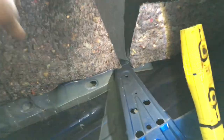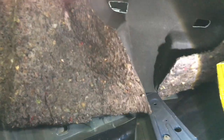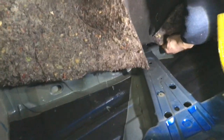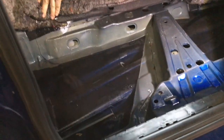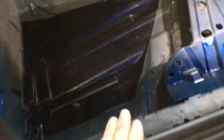This has got felt material — it's not the normal. Most cars have foam, and foam can hold the water and it can be a bit more difficult to get the water out, but it does come out. You have to get a suction machine on there and suck it out. The water at the moment you can see it dripping off, but that's because it's fine on the lowest level. So because it's only wet on one side, we're going to strap the carpet up and then suck the water off.